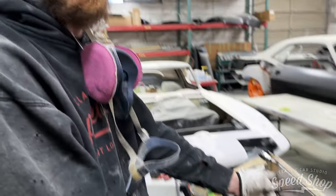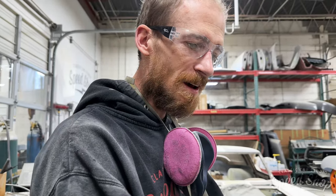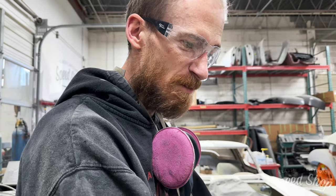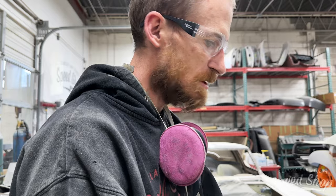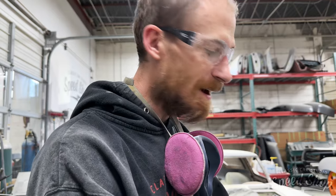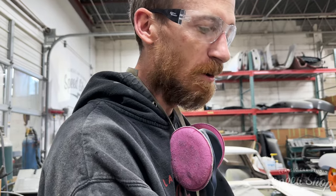Well, this is just a form for aluminum that I'll put in there. I'm going to glue this in and leave it because I can't get to the back side. Like I said, I'm making a permanent form out of aluminum. I'm using aluminum so it doesn't add a ton of weight to the dash, but I'll leave that piece in there, and then I'll just use the aluminum tape on the sides and the bottom, because I can get to the sides to remove that, but I can't get to this top side, so I don't want to use tape up there. I want to use something stronger and a little bit more permanent.